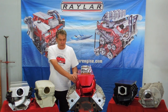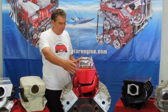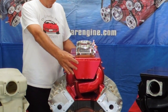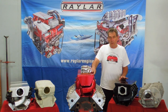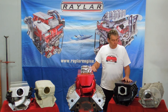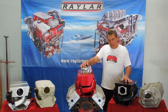For this manifold, they have cast runners. It has CNC parts, cast runners, a sheet metal box, and it takes a really good fabricator to put it all together — our welder is just superb. But this manifold requires a lot of time to source all the parts, have it fabricated, and put together. This one flows probably around 2,000 CFM, while this one flows probably 1,300 to 1,400 CFM.